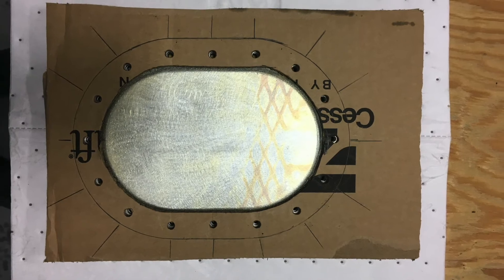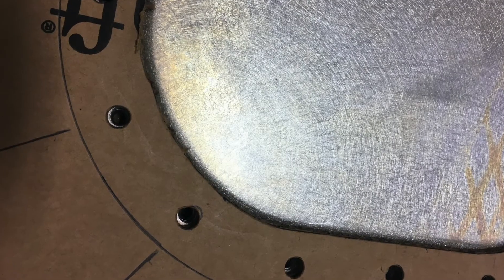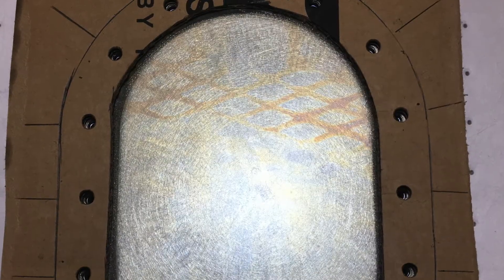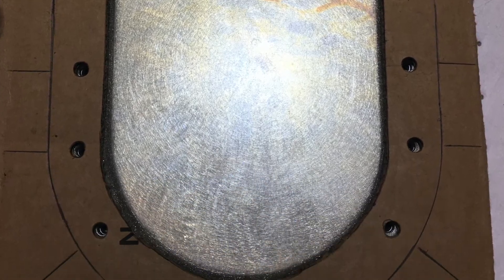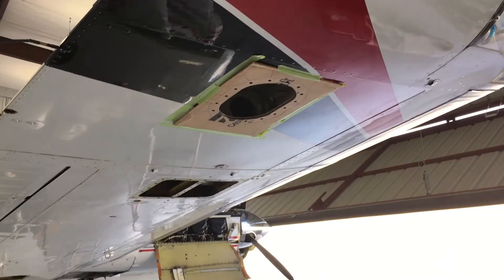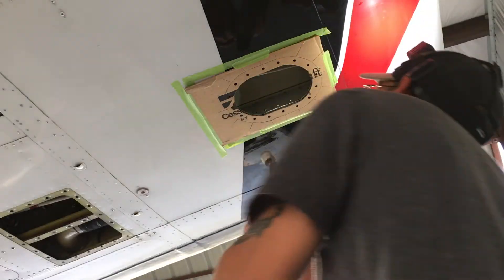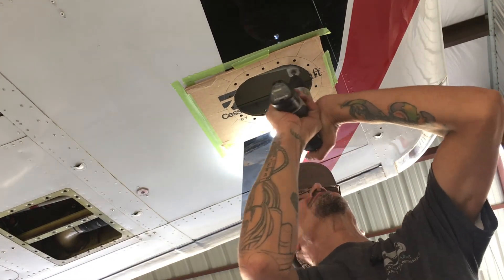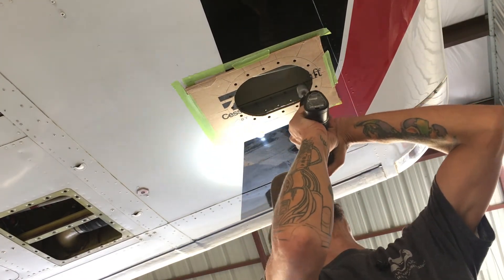The panel came in this morning and I still need to shoot it with paint, but I was able to line it up with my template, mark my holes, and pop them with a hole puncher. I try to make this template as perfect as I can because that's what's going to give me my center hole — when I go to drill I'm going to use a center punch on that. So that's how my morning started. Here's the pre-fit, and you can see it needs some work.